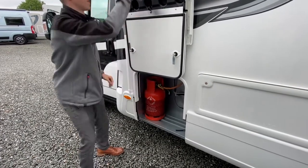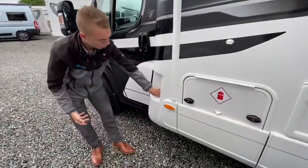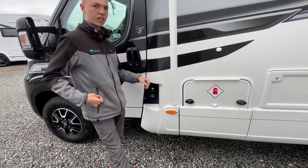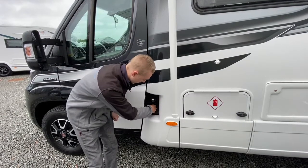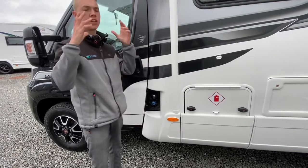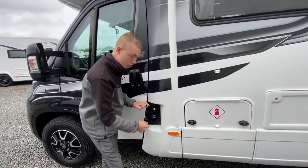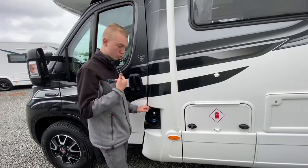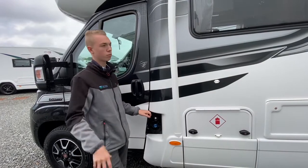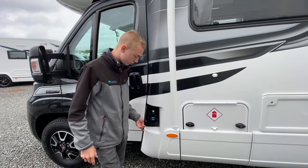Coming around here you've got your diesel and AdBlue. It opens with the main ignition key. That's your diesel, and for AdBlue simply take the cover off and fill. You'll get a light between the fuel gauge and the temperature gauge — a little orange exhaust light. When that comes on it'll tell you how many miles until the van simply won't start, so keep an eye on it. It's a 20-litre tank, so as soon as the light comes on just top it up. You can get it from most petrol stations as most new cars and vans have it.